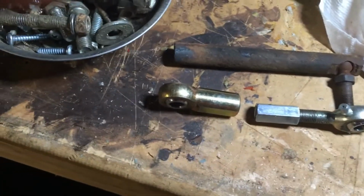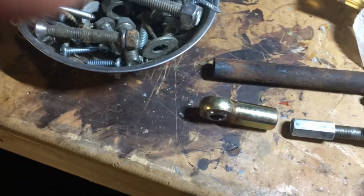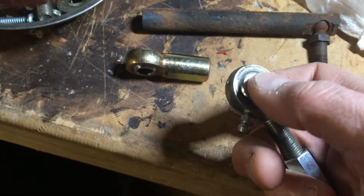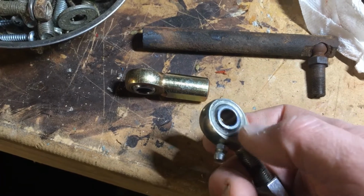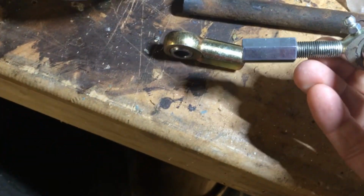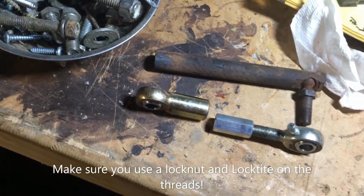When you install it, you're going to need to install some washers to make it align correctly, otherwise it's going to go in crooked. When you install the washers, make sure that they're small enough so that they don't hit the outer edge of the joint. You want them just big enough so that they wrap around here. And you'll probably need 4 on each one. And then you just bolt it up and you're done. And your shifter's going to feel like new.